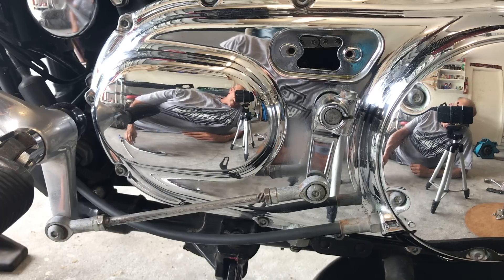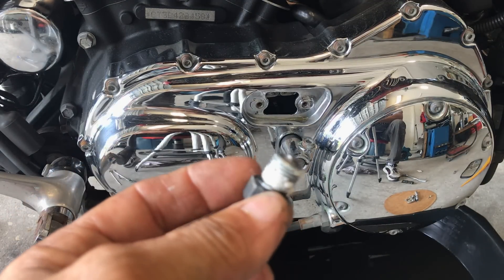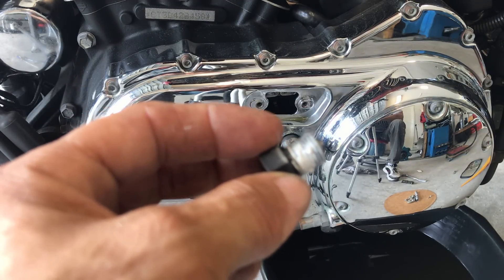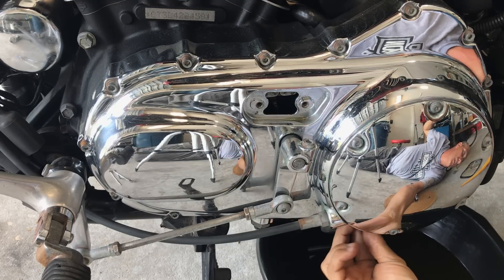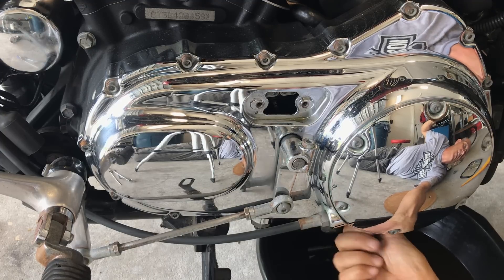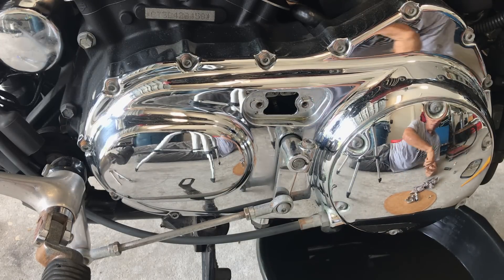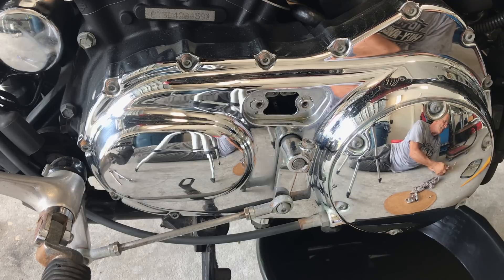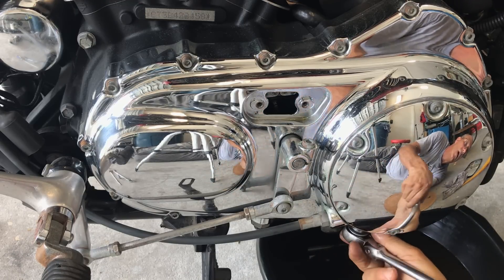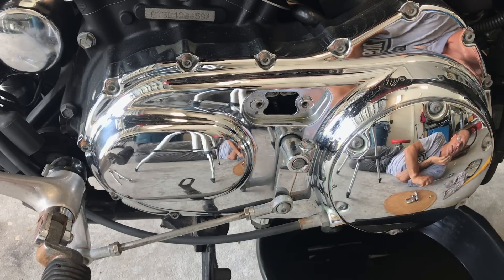Put the plug in and put a quart of primary fluid back in. Now with a little thread sealer, I reinstall — and this will never leak. You'll see I still got my rubber O-ring, but this little sealer is like an insurance policy. I hate leaks. Always thread the plug in first by hand, then give it a nice little snug with the socket.